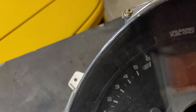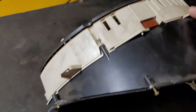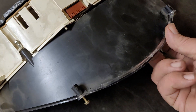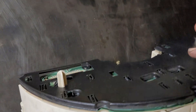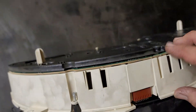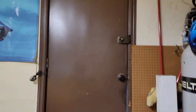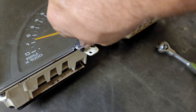So what we're going to do today is tear this one down. You can see physically it's a lot different than the other cluster. I've kind of pre-started on this just so we don't spend an hour getting through it, but there are five different sections here: an outer bezel, the frame, the housing assembly for your instruments, a back cover, and inside there's only one circuit board versus two circuit boards on the earlier C4.